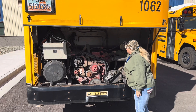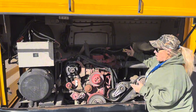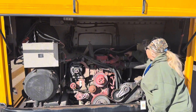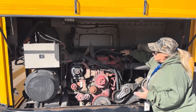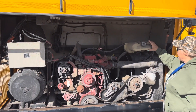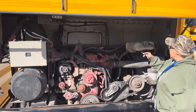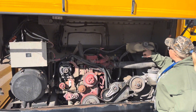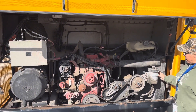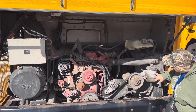This is our oil. We're going to take the oil dipstick, pull it out, wipe it off, and reinsert it. We're going to check that we're at the proper operating level so we don't burn up our engine. Then we've got our antifreeze, our coolant. On this kind of tank, you can put a flashlight underneath it to make sure you are at an adequate level. This is our power steering fluid — you can see that we're at an adequate level by looking in here.